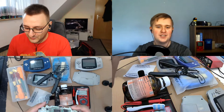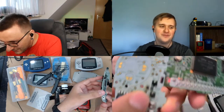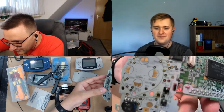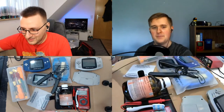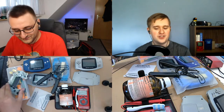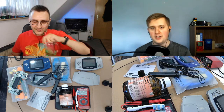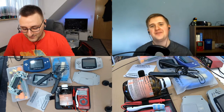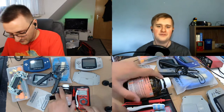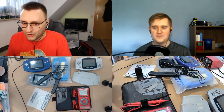Do you still want to look at this board when we're allowed to see each other again? Yes — I want to know what's wrong with it, I want to know why it broke. We thought maybe the soldering point was the issue, but it wasn't that bad. We tried to debug and check which points are wrong. We checked voltage across the positive battery terminal and ground points on the board — any point on the board. And all of the board is grounded when the switch is off, so that doesn't work. Of course, there's three volts across that.